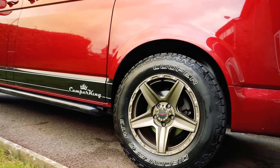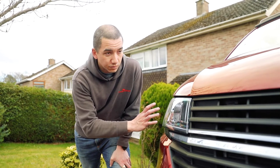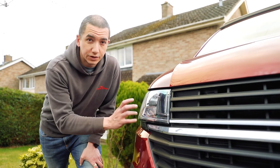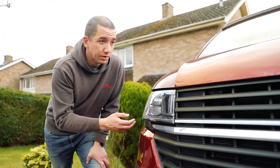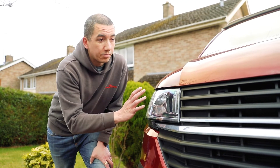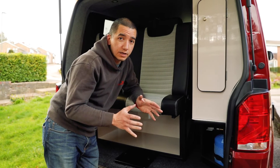Have a good look at your lights before you set off. Rainwater has a habit of finding its way into the light fitting, so if there's any condensation in there, you'll want to try and get rid of that. Also make sure the lights are in good working order — especially if you're going to be travelling at night. You might have a bulb that's blown, so check all lights are functioning as expected and replace any that need it.